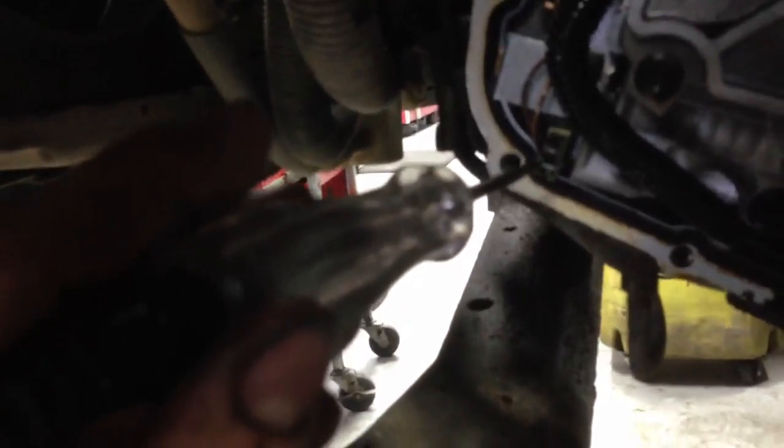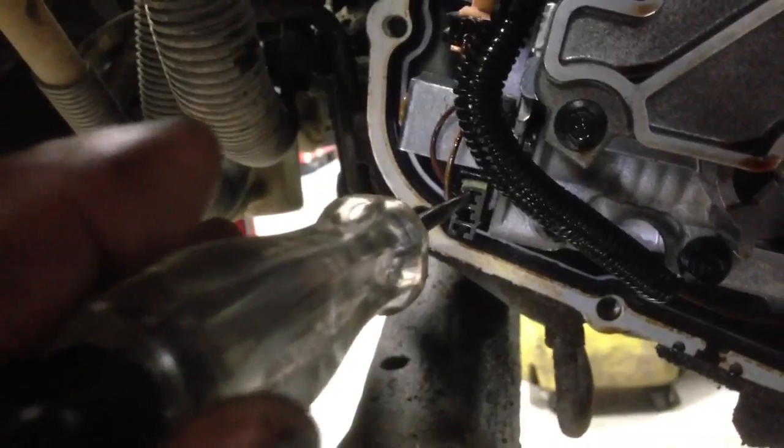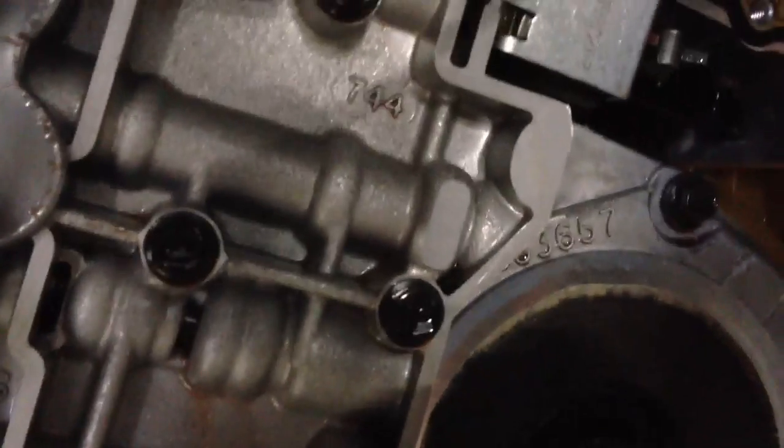What you're going to do is probe all these solenoids here, and you're going to want to see if the test light illuminates between ground and these terminals on these solenoids. So let's try this one first — light up, light up. So most likely that solenoid's good. Let's try this one — that lights up and that lights up. Now this one here, this is a pulse width modulated solenoid for the pressure control. One side is going to be steady, another side is going to pulse really quick — so there's steady, and there's your pulsing.